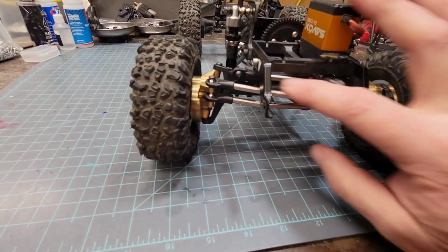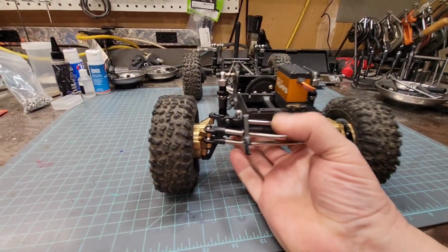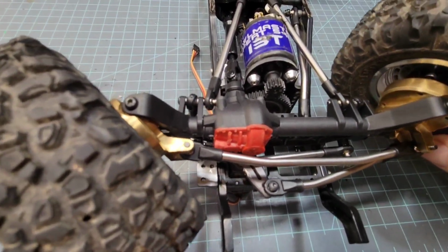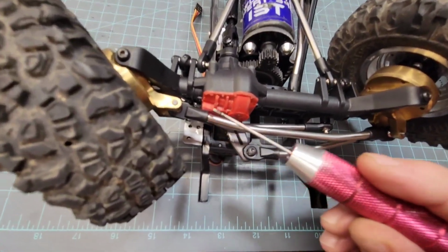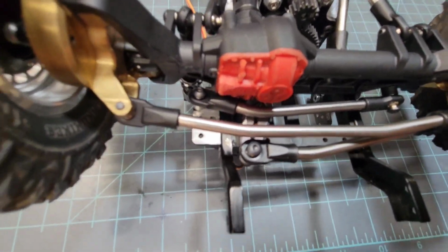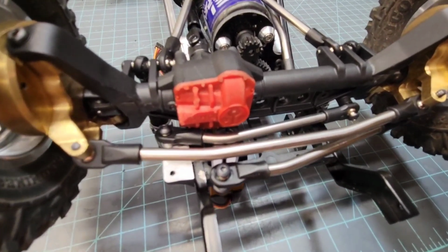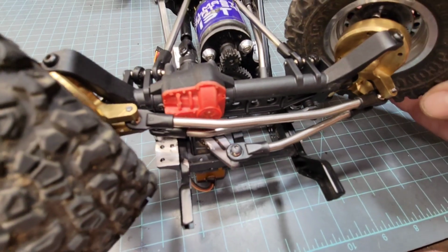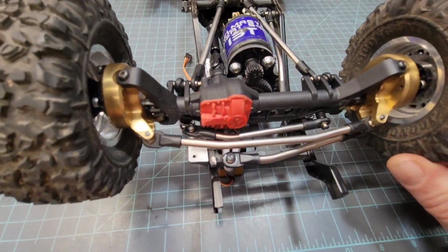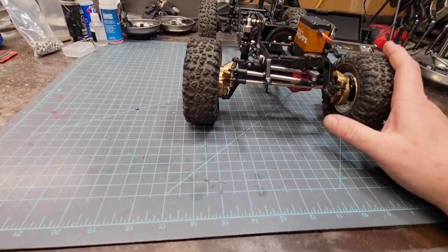So once I got all that in there, and I put the tie rod from TNT KUSTOM WORX, which came as part of that kit, when I turned it full way one way, this rod end was hitting that cover. So all I did was a little grinding on that differential cover. And I'm probably going to do a little bit more because it still stops it right there as well. That's okay. A little bit of grinding, she should be good. All right. Thank you for the comments.